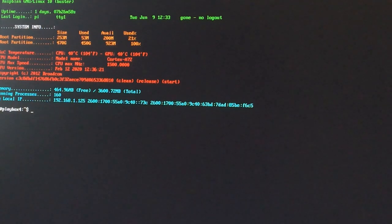2 terabytes. Because right now Virtualman only has 1 terabyte of games that he released. So I think by the time he finishes, maybe it will be close to that. So it's good to be safe and get 2 terabytes. But I would not get anything bigger than that, because the Linux operating system for Raspberry Pi does not support anything bigger than 2 terabytes at this moment.